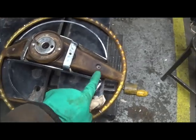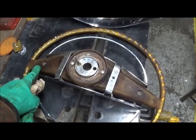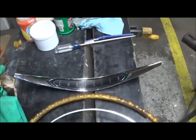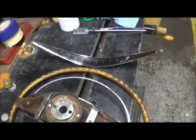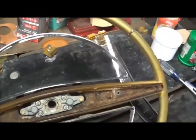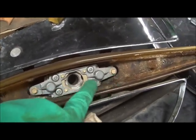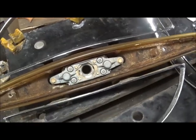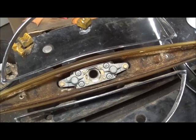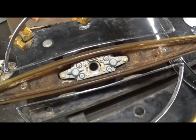On the back side of the wheel you'll find two Phillips heads exposed. Unscrew those and that allows you to remove the decorative plate, and you end up with access to the retaining ring for the horn. That is detached with two screws here, and this unit is the horn switch, which is unique to tilt wheels.